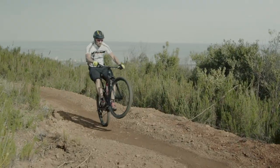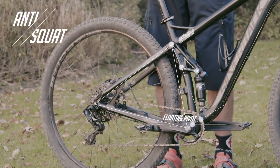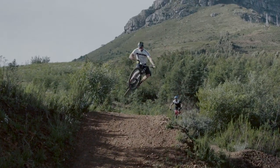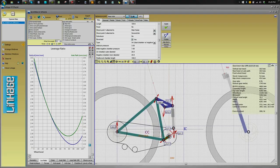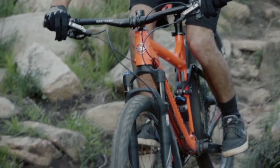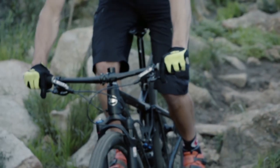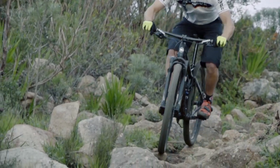The system's pivot point is floating, meaning that it changes location as the suspension moves. We have designed it so that the pivot point moves downwards through the travel, reducing anti-squat on big hits to avoid any unwanted pedal feedback. The upper linkage design creates a progressive leverage ratio that results in great small bump sensitivity as well as large impact absorption. This bike gives a nice supple feeling off the top with a smooth transition into a firm mid-stroke.